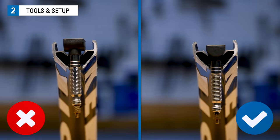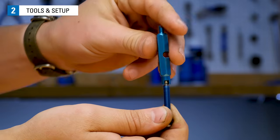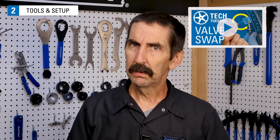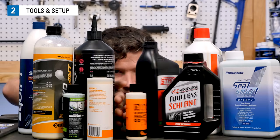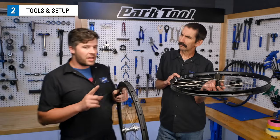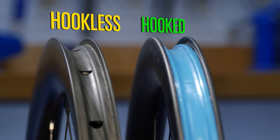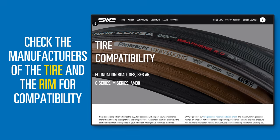You'll also need a valve. Some things to consider are that it needs to seat nicely against the rim, and you'll need to make sure that it's long enough for the depth of your rim. We also find it's important to have a removable valve core. Schrader valves are also an option — check out this video for installing Schrader valves. You're going to need a tubeless ready or tubeless compatible tire, which typically says so right on the tire. Sealant is typically required, and there are many on the market to choose from. Finally, you need wheels that are also tubeless compatible — if in doubt, check with the rim manufacturer. It's important to note if you have a hookless rim, which lacks the hook on the inside of the rim wall. If you have a hookless rim, be sure to cross-check compatibility with both the tire and rim manufacturers, as not all tubeless tires are compatible with all hookless rims.